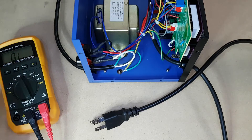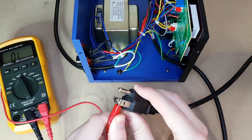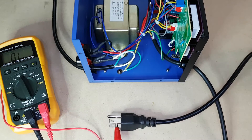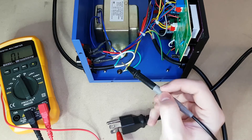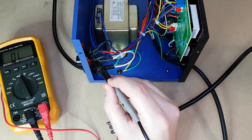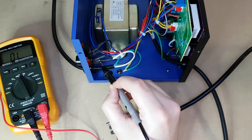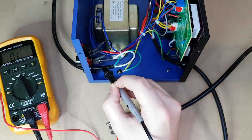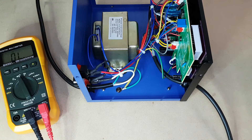In order to test the continuity here, I connected a crocodile clip to the probe. I'm going to attach it to the side that should be neutral, and then check with the probe to see if this white wire is actually neutral. The switch on the back is set to off. If I contact where the live is coming in, there's no continuity — which confirms that is definitely 100% neutral and it's 100% switching on neutral. Very poor design.